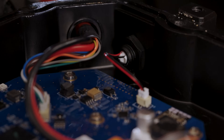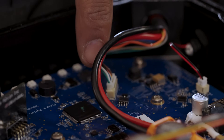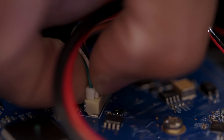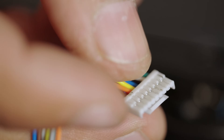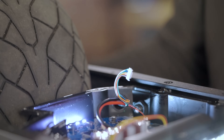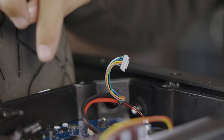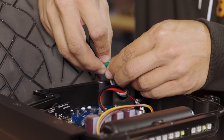Coming in here, this is the battery cable, separate from this cable — this is just a switch. You have the main power cords coming into this connector and then you have communication wires. We're going to pull the communication wires out first — there's a little locking tab right there, squeeze that and pull it straight up. Let me show you why we put tape over the connectors: without protection, just using my fingers and not even touching against metal, I can actually turn the battery module itself on. If these wires were disconnected, the lights wouldn't come on and I'd have no idea if the battery module was on or off — and if I went to plug this connector in, it could spark, it could electrocute me, it could damage your controller. So be sure to tape over your connectors — just take some electrical tape and toss it over the connector.